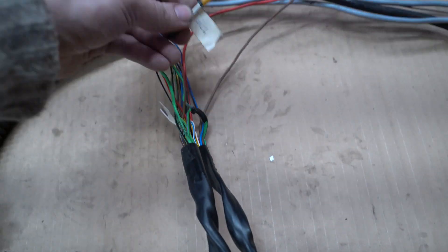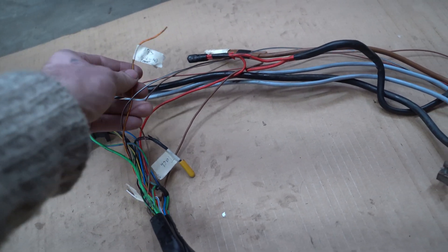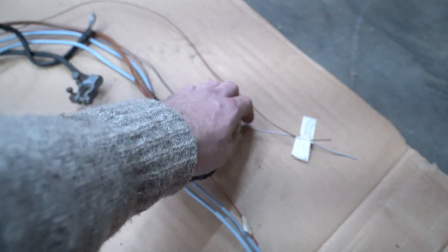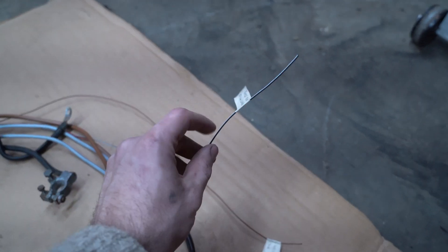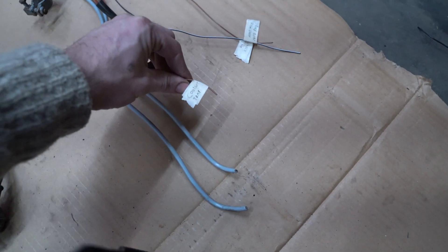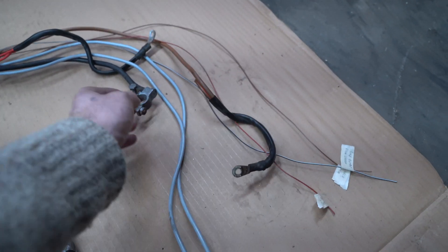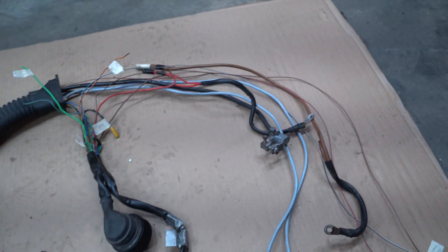What I am keeping: there's a wire for the tach, switched power, I need to wire ABS power, I have a wire for the check engine light — I don't know if the Haltech has that — speed output, I'm also not sure if the Haltech has an input for speed, coolant temp which it does need, crank position sensor and cam position sensor, and then just ground and power for the alternator and starter. And that's it.